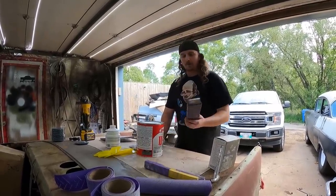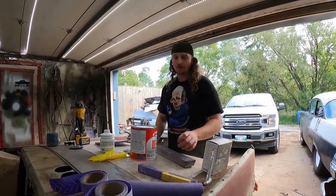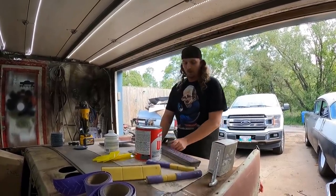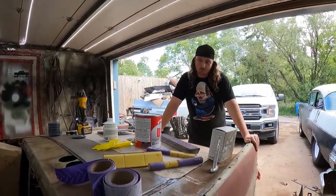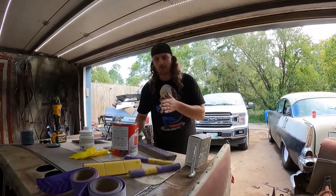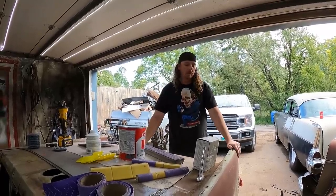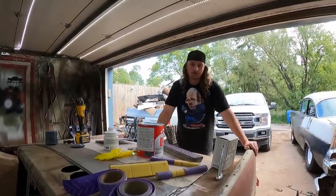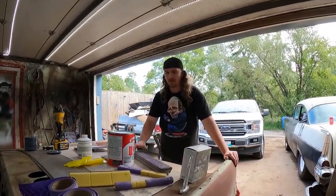These are all my blocks we're gonna use. So this is the big one. I love this big Dura block. I got teardrop shape and square, round, and a couple of smaller ones for flatting out. So what I do with body work is it doesn't have to be exactly dead straight, as long as it's true. You know what I mean? So your eye's not drawn to it being all wavy. When you see people running a little palm sander on something, that's going to create all sorts of waves. And at Edie's Beach Shop here, we have nothing but the best. So that'll flatten it out.